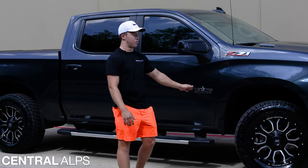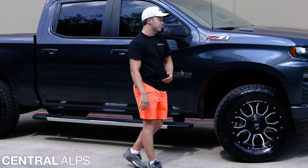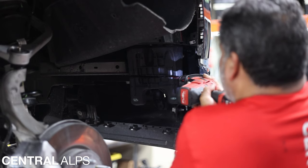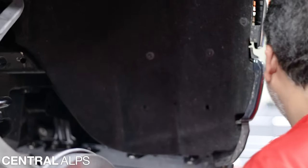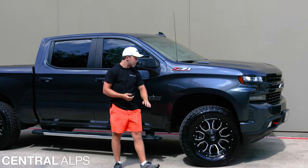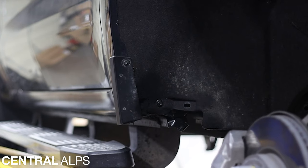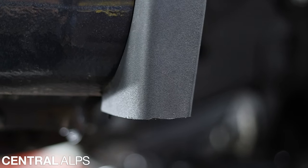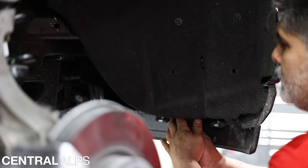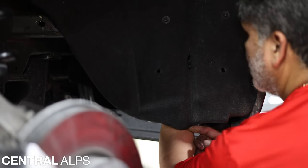Stock, no, we cannot fit the tires — they do rub a little bit. What we do is shave off about half the fender liner bracket and put self-tapping screws in at a higher point to keep the wheel well liner off of the tire. We trim off a little bit of the bottom, then come back and trim off the fender liner bracket and a little bit of the mud flap in the back. Then we zip tie the fender liner to the bumper bracket in the front.